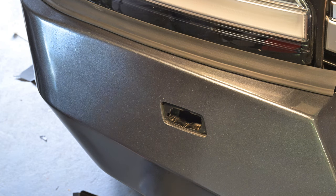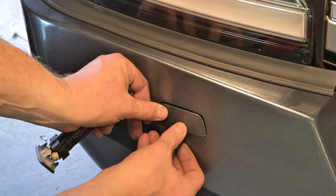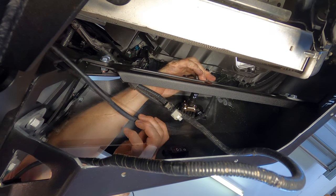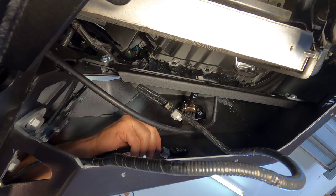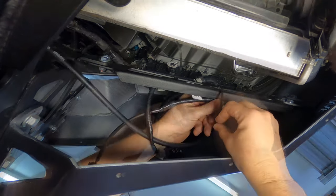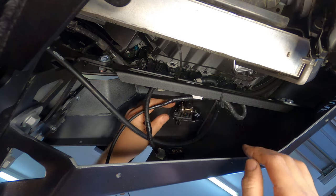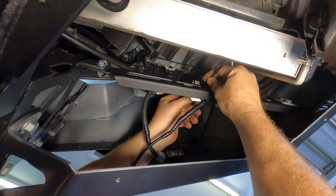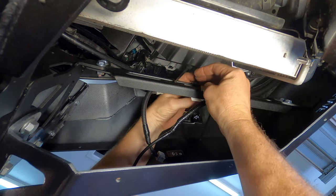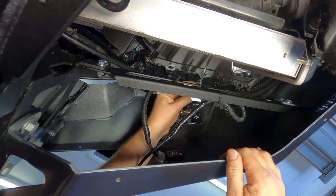Before you refit the underwing plates, it's time to finish off the bar accessories and the wiring. First, insert the headlight washers through the front of the bar then refit their metal retaining clips. Connect the hoses to the rear of the washers, then reconnect the parking sensors to the wiring looms using the extension cables that came with the bar so that the loom can reach each sensor. Once everything's connected, use cable ties to tidy up all the wiring to the sensors, camera and fog lights, plus the headlight washer hoses so they don't rub or foul on any sharp edges. Ensure that you leave some slack in the fog light plugs so that they can be connected to each fog light, and don't kink or block the headlight washer hoses by over-tightening the cable ties.